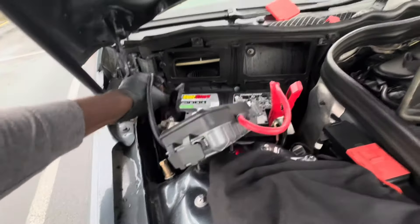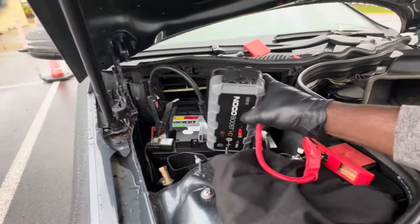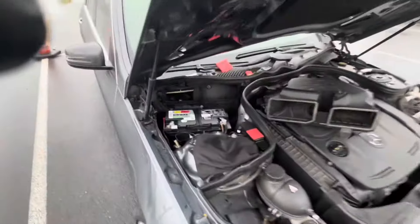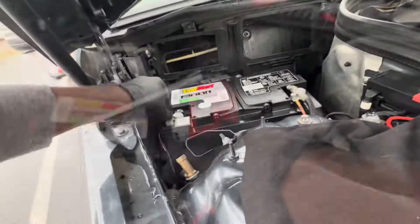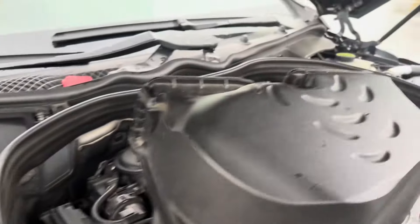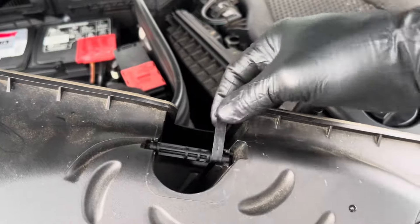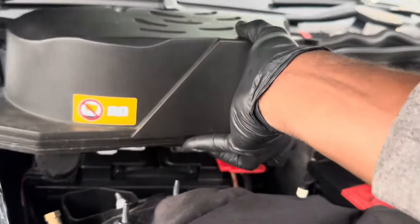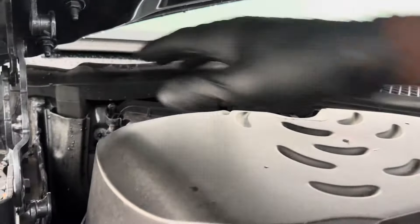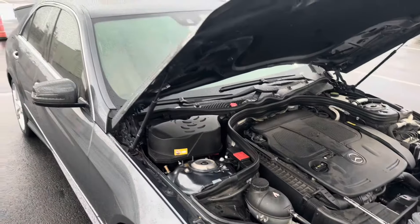Remove that cover, then we can just easily remove this. Turn the jumper box off and move the jumper box — this is in place. Now I just grab my 10 millimeter and tighten this thing back up, tighten that one too. Put the red cap on, and this piece that came off the top of the air filter box — we'll just seat that back in place. Slide that right back over, insert that, and the next one on the opposite side. And that's how you replace the battery on a 2013 Mercedes-Benz E-Class or flex fuel model.